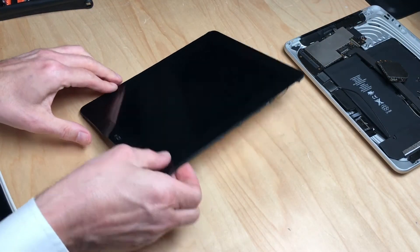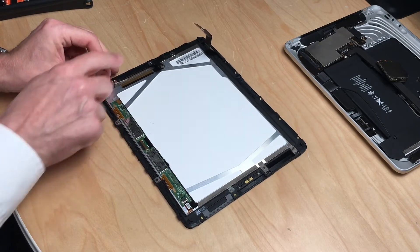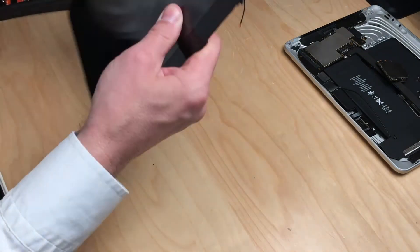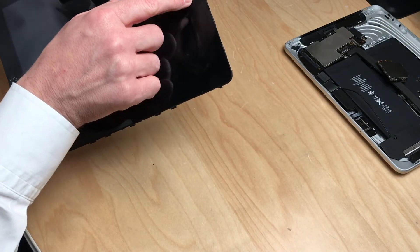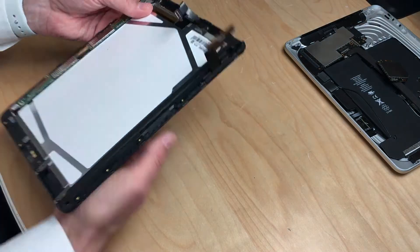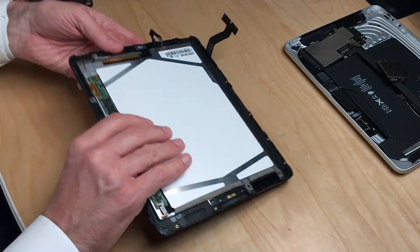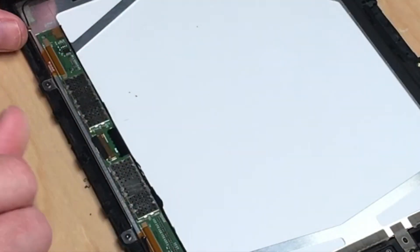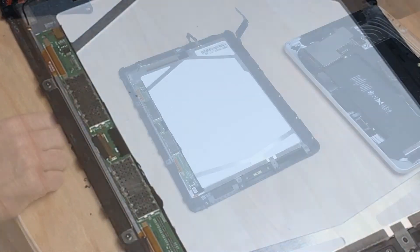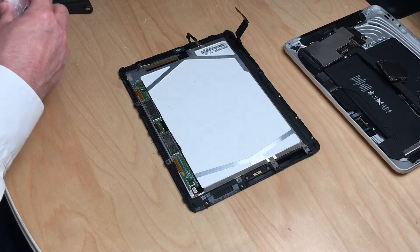The screen. If you turn the screen over you can see a few things. This is some kind of Wi-Fi antenna which runs around the screen. Over here is what I think is a light sensor — not a camera — because it's an iPad 1, which turns the screen brightness up and down. This is the touch assembly, the touch surface above the screen. To connect the screen itself and the backlight you have this little port connector with a cable which I already took out.